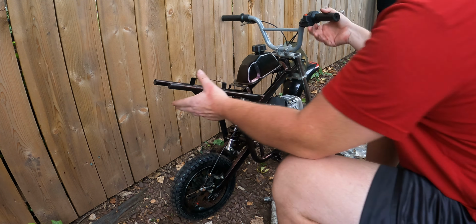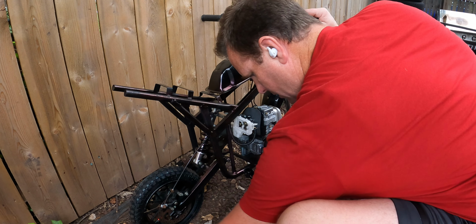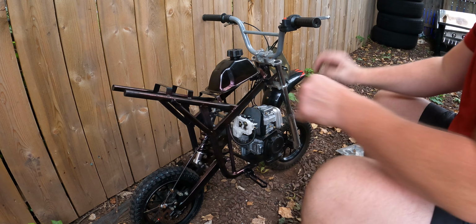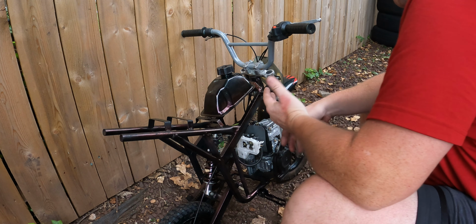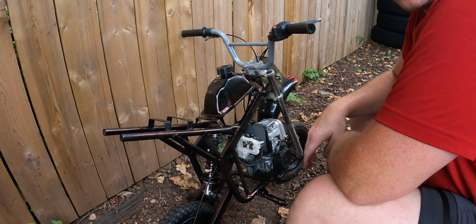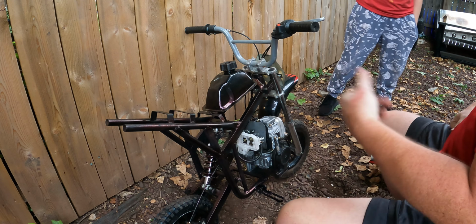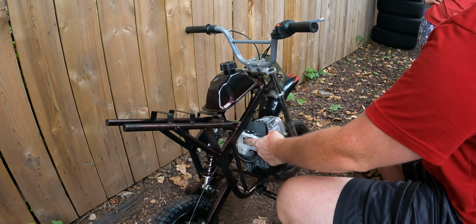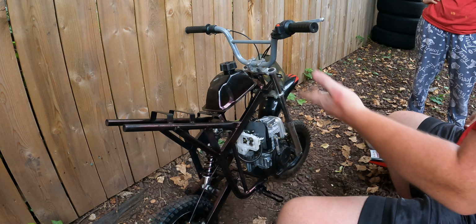Weird, it's like it's not getting enough fuel, but when I cover up the choke port, it does good. It needs more fuel. So how do we give it more fuel? It will idle, but anything after idle, it needs choke on it. That's why I'm putting my finger there to block the intake.